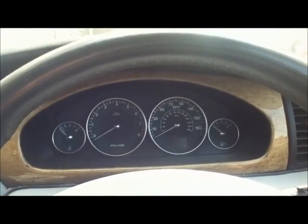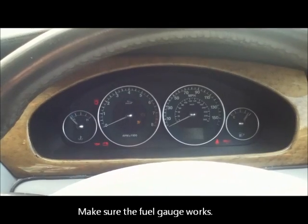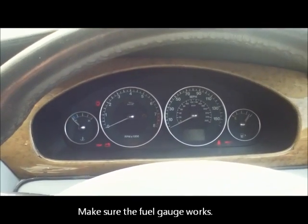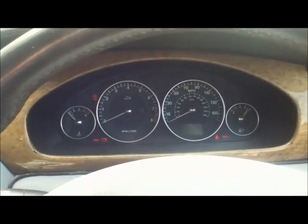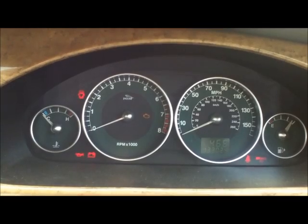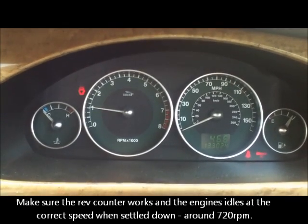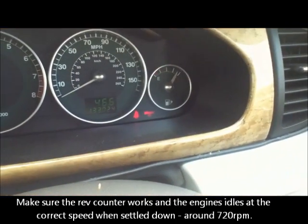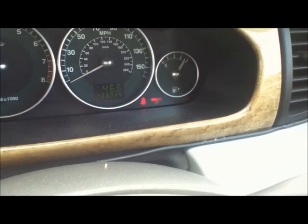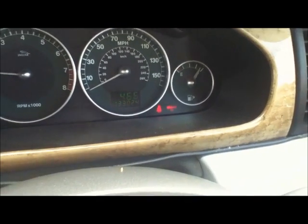So turn the ignition to second position, see all the lights come on. All the check lights are on. It's showing me the engine management light, the door lights, showing that everything works. Now you have to be very careful. Watch the engine light, make sure that doesn't stay on. So that's gone. The ABS light, check light comes up. So the only thing left on is the handbrake, which is obviously on, and the seatbelt light, which should go off when I turn the seatbelt on.